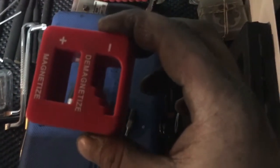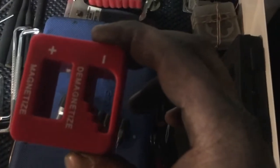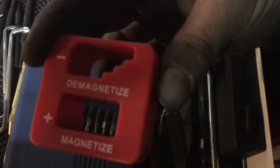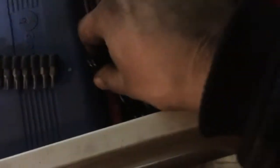Also in the miscellaneous drawer: scrapers, extra keys for stuff, and a big tap magnetizer and demagnetizer — I love this thing. If you've got a screw that's going to be hard to get to, run the screwdriver through the magnetize side to magnetize it, and when you're done run it through the demagnetize side. A couple of plumb bobs for chassis work, more drive bits, little mini screwdrivers.